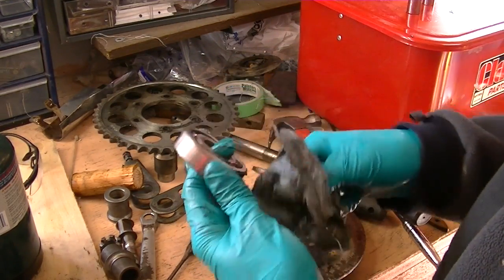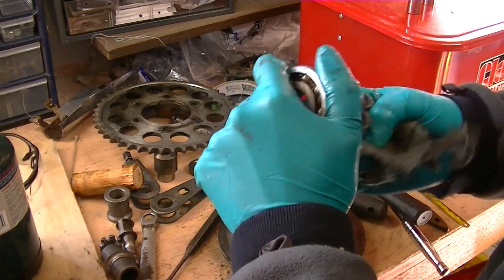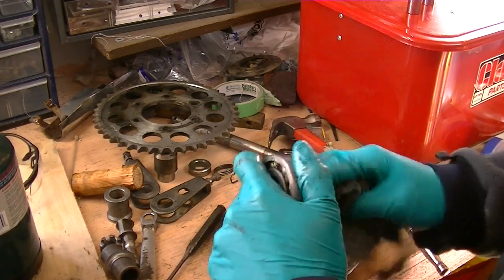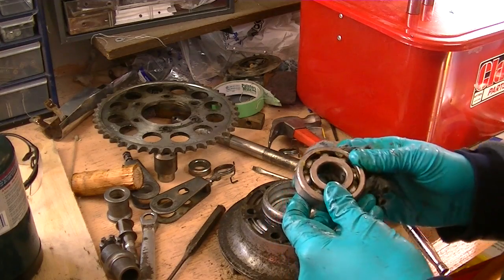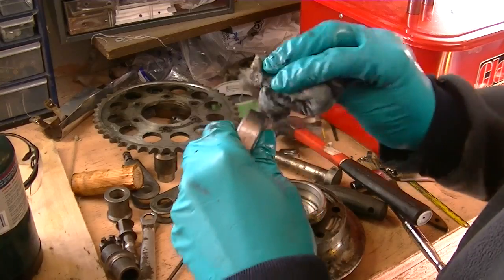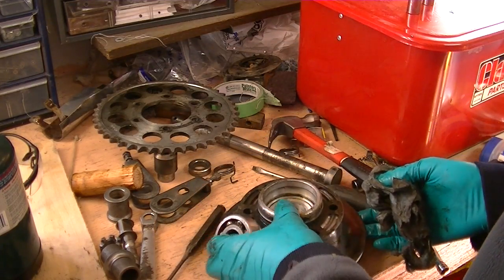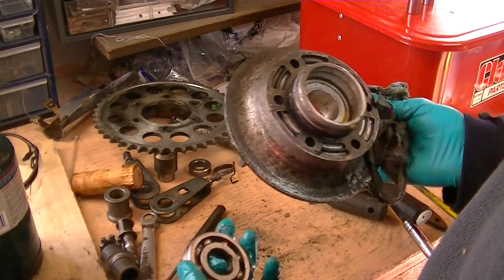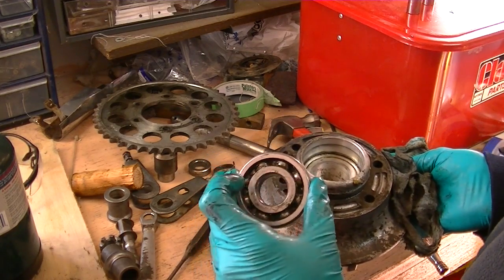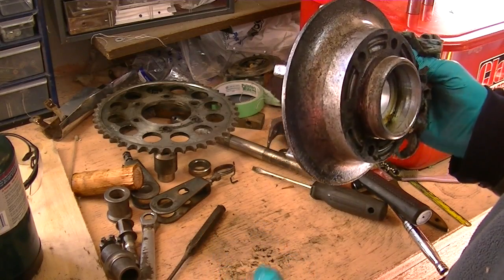That is a stout bearing. And it's actually still good. No sign of water. Grease is good. Like I said, I think I have a replacement for that, but I also wouldn't really mind reusing that if it came down to it. Alright. So, next up, give this one last rinse in the solvent tank. I'll rinse out the bearing too, because if I ever use it, it'll definitely get repacked with grease. Quick trip to the wire wheel, and we'll see how these clean up.